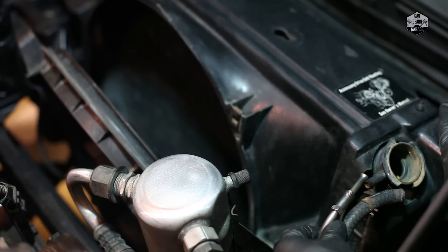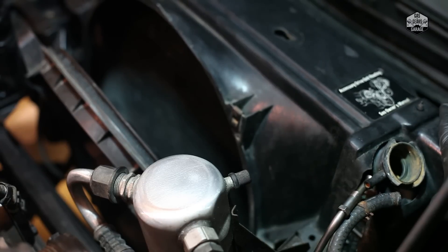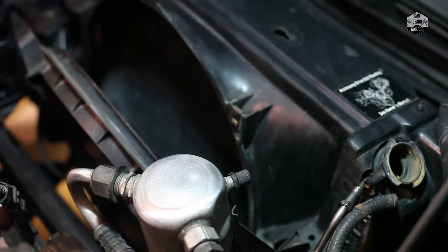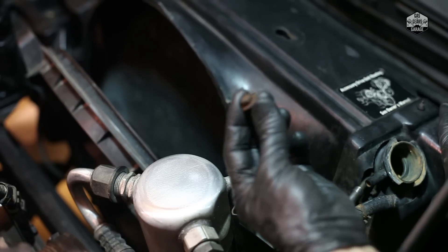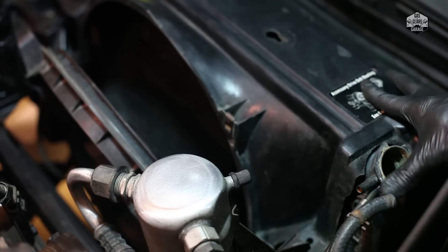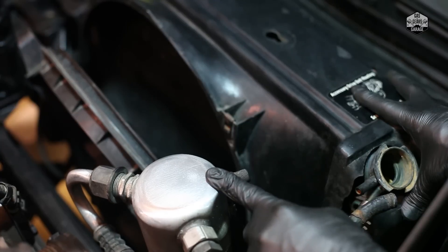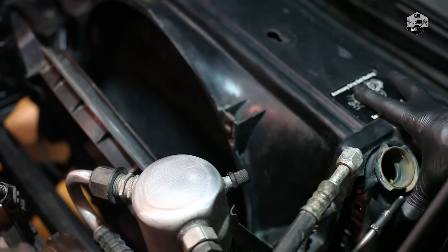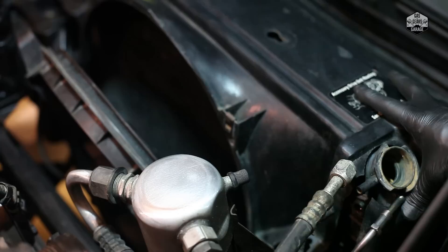My recommendation is: if you can get rid of the old transmission oil lines, do it — you're going to save yourself a huge amount of heartache. They're so stiff and rigid there's absolutely no way to get them out without breaking them. My thought is they were put on right before the engine was dropped in. Now, you're going to be using 10-millimeter bolts to hold the cover on, some attaching to the AC condenser itself. I don't have a condenser — I had that removed prior to other work.